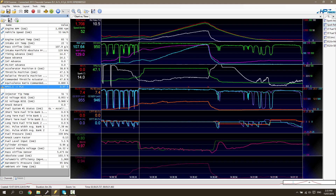Once we've gone to wide open throttle and start the run, we can see that our equivalence ratio commanded and our measured air fuel ratio value match very closely. Particularly at the top of the run, the two values are exactly the same — and again this is a sign of a well-tuned ECU. If our measured air fuel ratio matches our commanded, it means the ECU knows the correct amount of air entering the engine and can supply the correct amount of fuel. If we were seeing significant errors — our measured air fuel ratio not matching our target — it would mean there are problems in our calibration that need to be addressed.